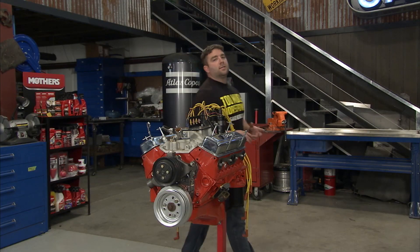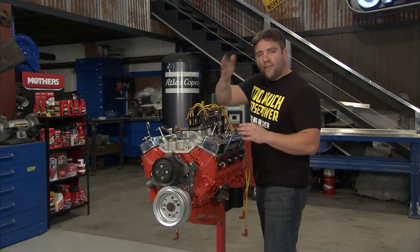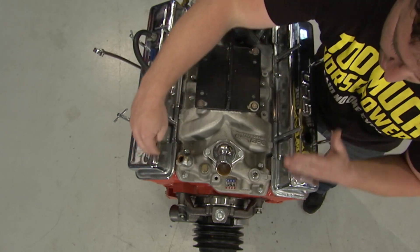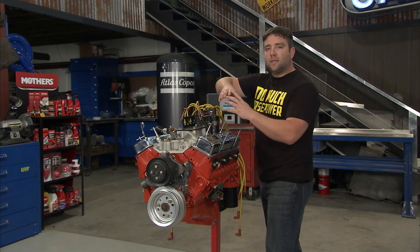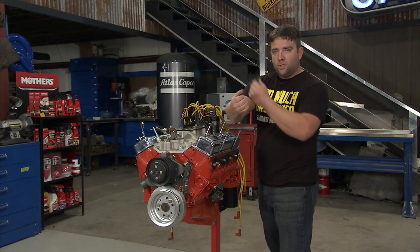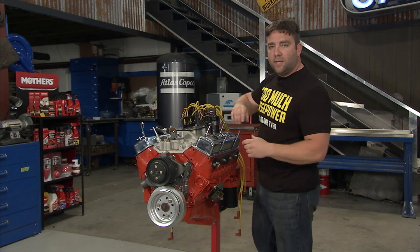The first step in this process is to figure out just which cylinder is cylinder number one. On an inline engine that's easy because it's the cylinder at the very front of the engine, but in a V configuration it's a little different. Typically with a V configuration you'll have one bank shifted ahead of the other, because all the pistons share a common crankshaft but they have to occupy a different spot on the same journal. So you end up with one piston ahead of the other. Everything is based on cylinder number one.